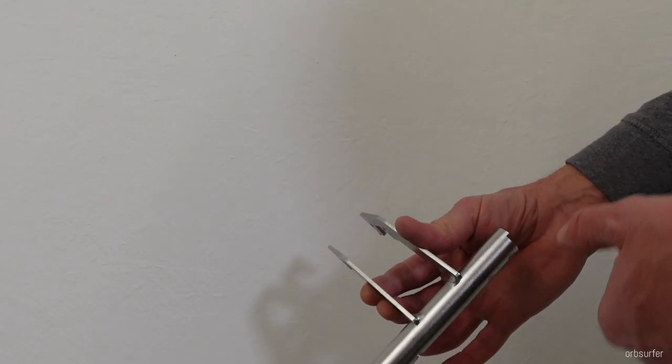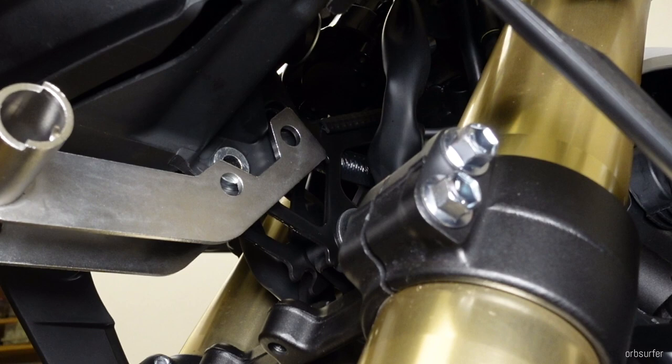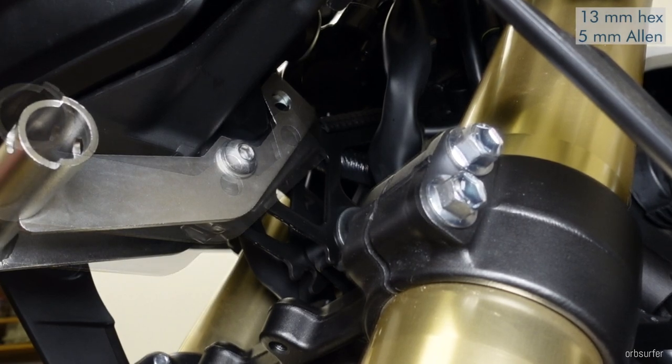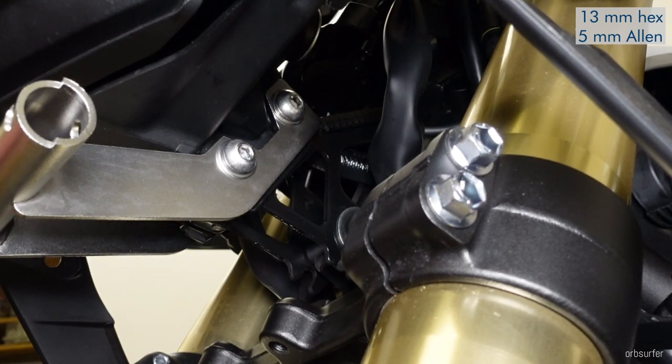The tubes connect to this little side pipe. First insert the two bottom original spacers, then slide the yoke over them, leaving enough room to insert the two top spacers. It takes a little patience but it's not that hard. You can see the plastic composite here — if you don't put the spacers in, you will crush it. On these two bolts, Turatec should have used hex heads at both ends because the small Allen holes are easy to strip. These two bolts are also completely hidden and cannot be seen at all.